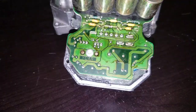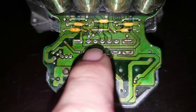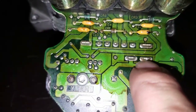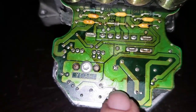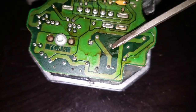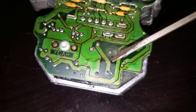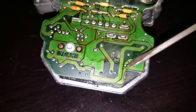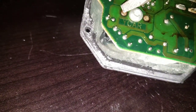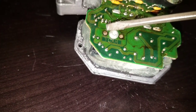Upon further inspection, I don't know much about electronics, but it looks like something was burnt — like liquid got in here somehow. Something burned out, something got wet. There's a bad solder there, and that channel looks burned out. I think it's going to be channels one, two, three, four, and five — those are usually the channels that go out when you're having problems with your traction control and ABS. This whole unit — I don't even know if it's worth salvaging. There's a lot of browning in here, things just look burned up.